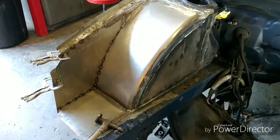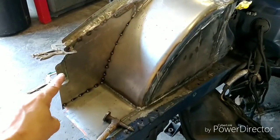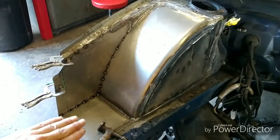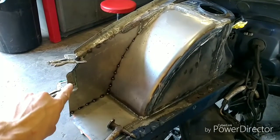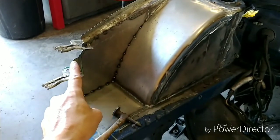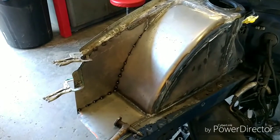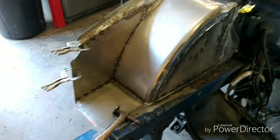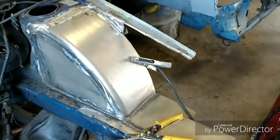I've got the side pan in and, as you can see, everything is right at OEM fitment. I leave just the little tab where the actual radiator support is going to weld to. You can see the spot welds here — that's all OEM. So with the OEM fitment, all of the plates are in the same alignment. I'm able to put it up, tack it in place, and basically just run a bead just like I've done here, and then replicate the other side as well.